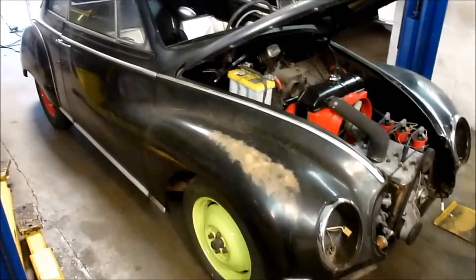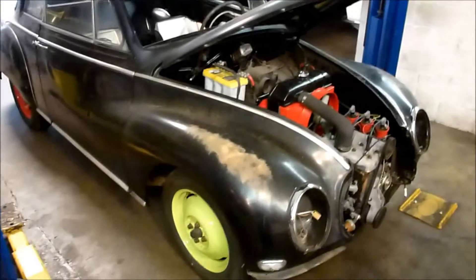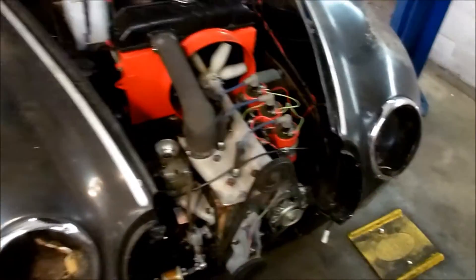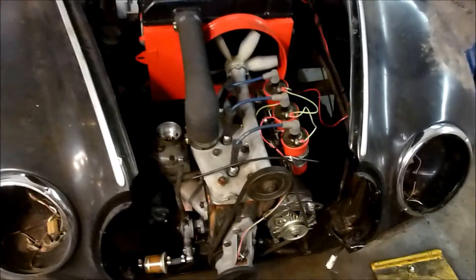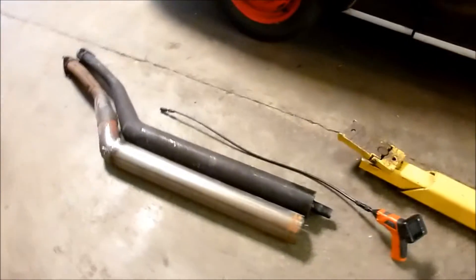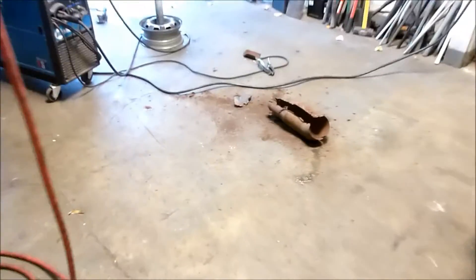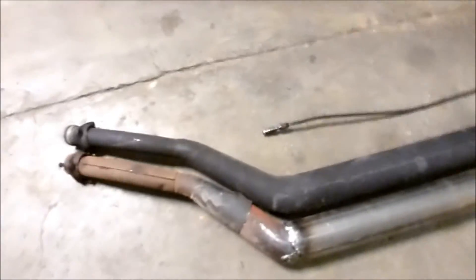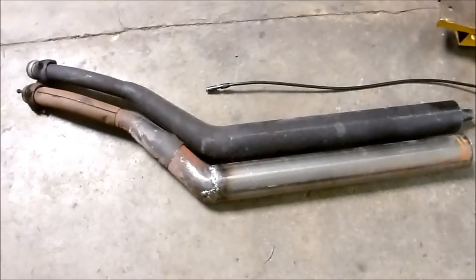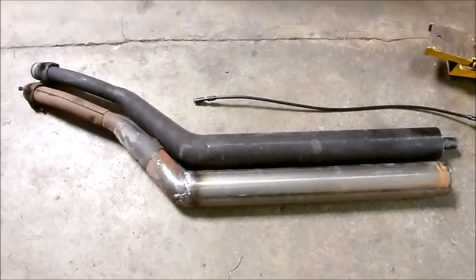I find myself in the shop once again working on my 1960 DKW, a two-stroke three-cylinder car. Someone was nice enough to give me an expansion pipe, and I had the remnants of a rusted-out one. I spent the better part of the morning welding, grinding, and cutting off all the old rusted stuff to get to good metal and try to reproduce one. The black one is the donor pipe, and the rusty and new metal one is the replacement pipe.